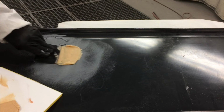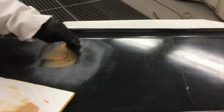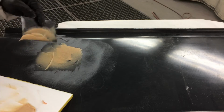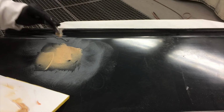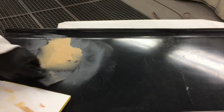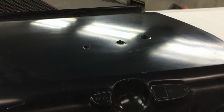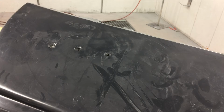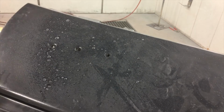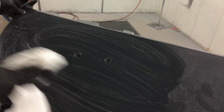After the reinforcement patch has been applied, move to the front side of the panel, mix up additional product to further reinforce the damaged area as well as provide the foundation for the cosmetic repair with medium dent filler or glaze. When working on smaller or non-structural repairs like these bullet holes, it's not necessary to use the optional reinforcement mesh. Clean the surface with wax and grease remover.